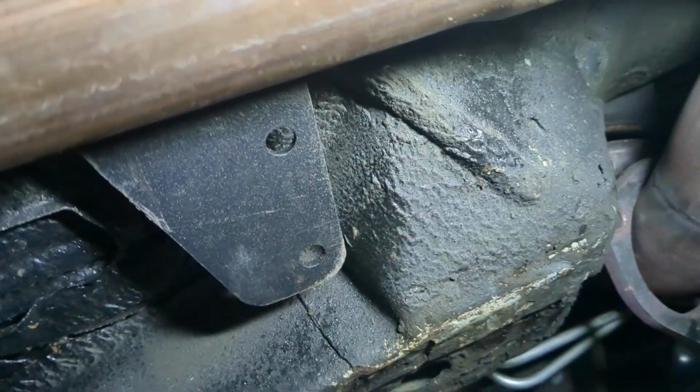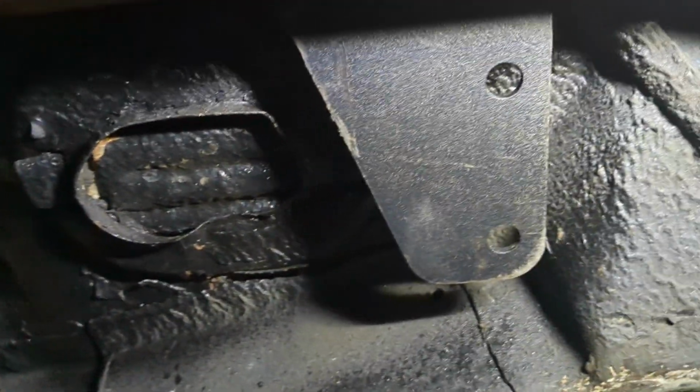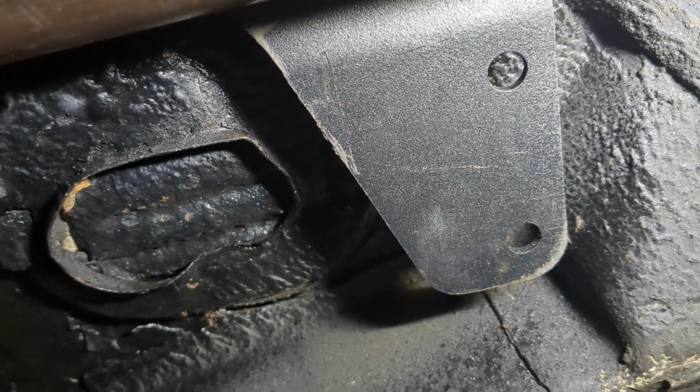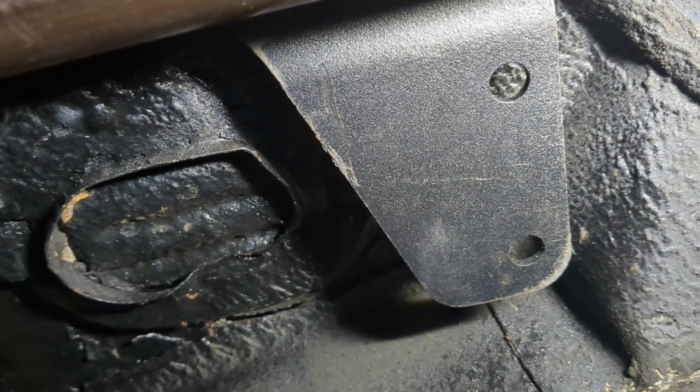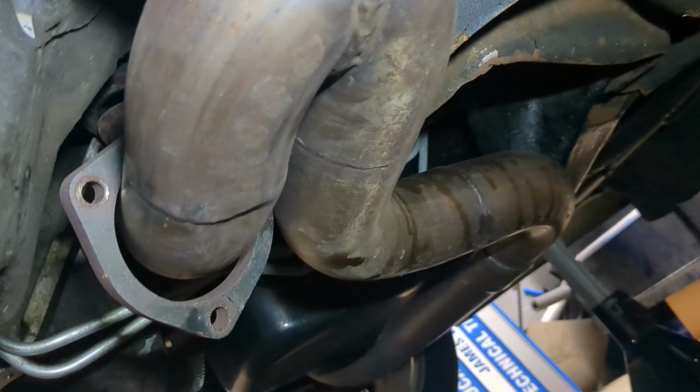What I did notice, and there's another video with this on YouTube, is that this flap doesn't make contact with the body. That looks just like mine. So my plan is, it's bolted up. It's very tight up here. Once I get everything modified and mocked up, we're going to bolt that in, take probably a couple jacks, and make that flat. It will go flat up against the body. You just got to persuade it a little bit. But, you know, messing with aftermarket stuff, and you've got an exhaust that's not stock, you're going to run into stuff like this.